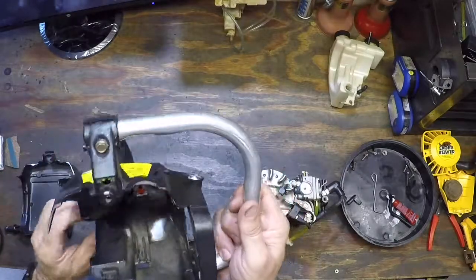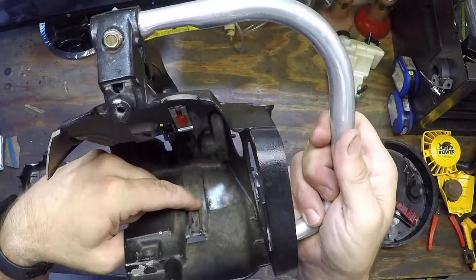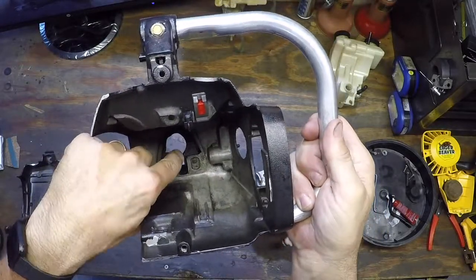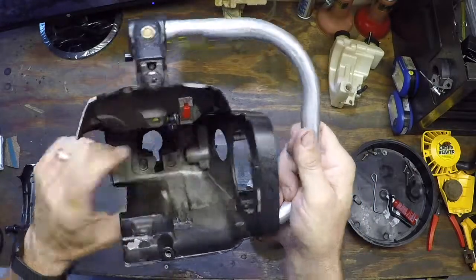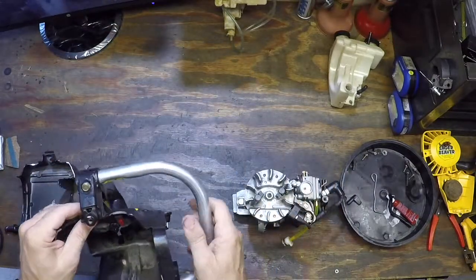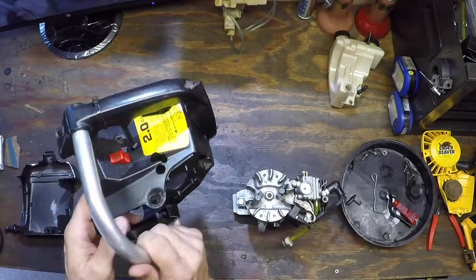What you've got to do is the fuel line has to be in this little channel right here. The spark plug wire runs on the outside and through this hole and out, and then gets pushed down into this little notch. And at the same time, you have to align the engine and the flywheel up to here. There are a few other things that you have to massage into place. Do a couple little things first before you get started — it'll make life a lot easier.